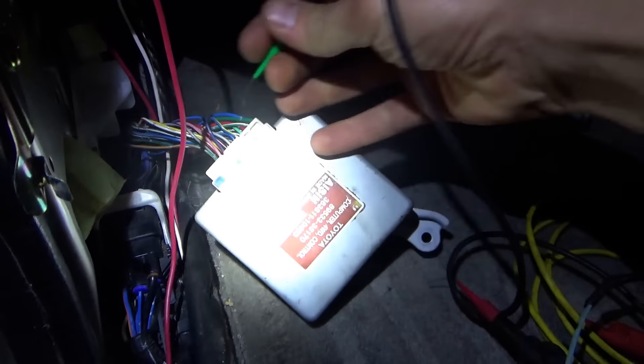So that might be an issue - this is the first thing that's suspicious. Now can we try turning on the diff lock and see if it engages? It's locked but it's not happy. Let's record all the numbers in this state. In 4-high locked mode - this is when the actuator is in the middle and it's blinking, not happy. I think this is a problem: this 4-wheel drive switch red and black went from 11.7 to 10.9; it should go to zero and light up our test light from battery positive.